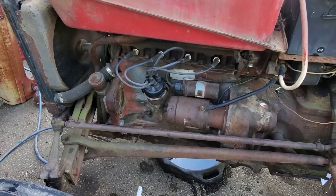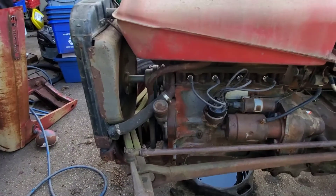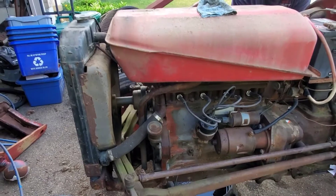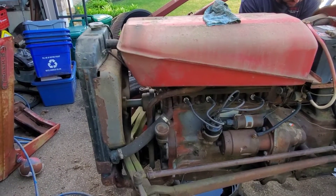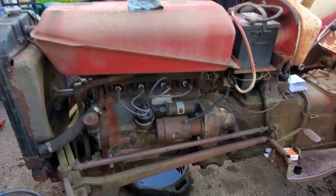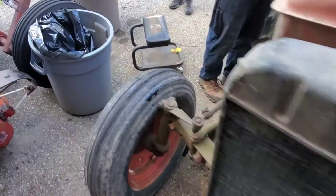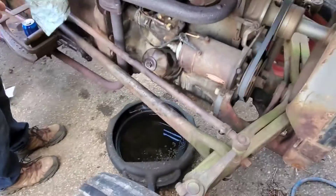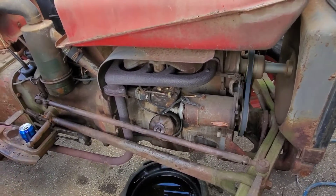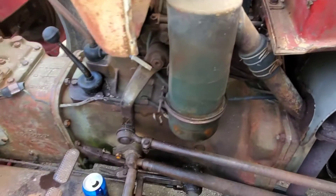They said 450 RPM idle in the book. Seems a little slow to me and there's a tiny little burble in the idle — not sure if we're going to worry about that. That fan extension piece is the most terrible thing I've ever seen — it's true on both ends but wobbles in the middle, not sure what we're going to do with that. We've got the new plugs in, new points, all that buttoned up. Took me a while to find the idle screw behind the carburetor and I burned my hand. Put oil in the air cleaner — she's all good, got good oil pressure.